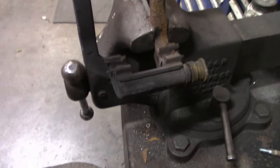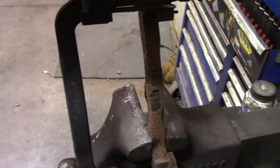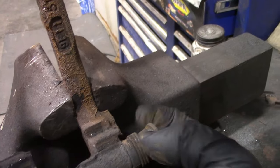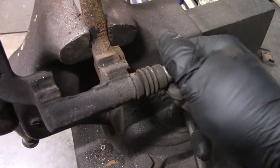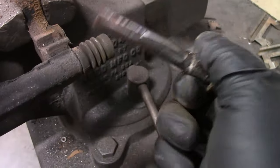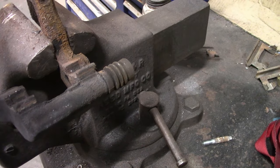Got this caliper mount all hooked up in my vise here. What you're gonna want to do is pop these little stainless steel slides for the brake pads out - both sides, top and bottom. Then you want to make sure your caliper slides are working good. There's a little rubber boot - I usually pull them off like that. This one's a little dry, I can feel it coming out. Yeah, she's dry, she's got a little rust in her. We're gonna shoot some brake cleaner in there and sand these pins up a little bit and re-grease them.